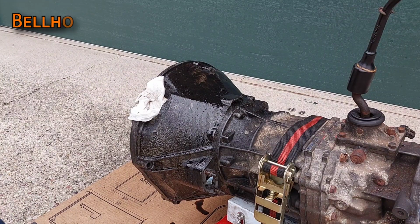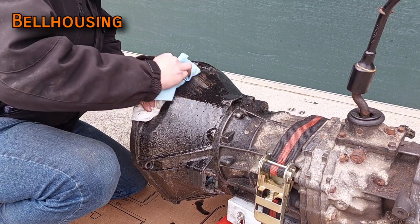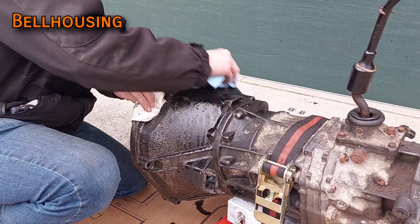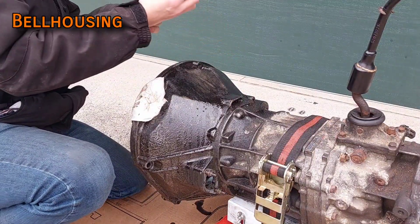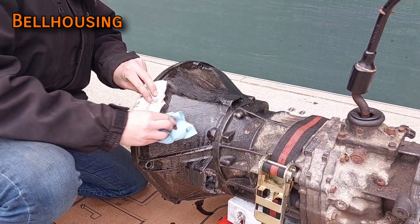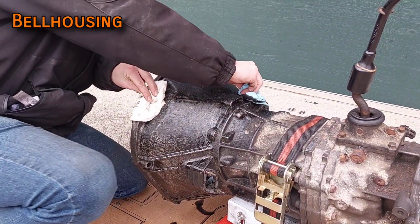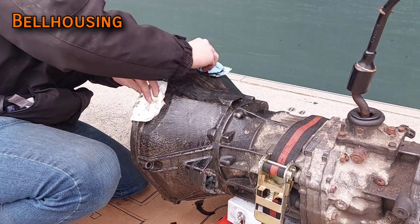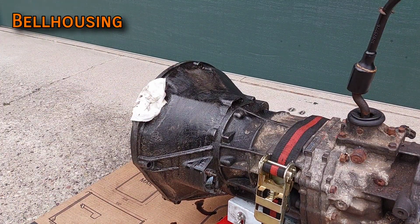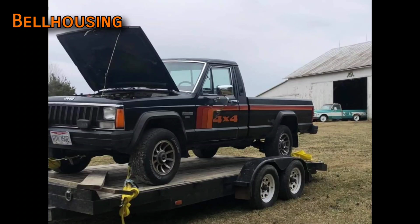You will need an applicable bell housing, but it'll probably already come with whatever transmission you're using. All 4.0s share the same transmission bolt pattern, so using an AX-15 or NV3550, you won't need any adapters. If you have a pre-1994 AX-15, you can switch it to an external slave cylinder by using a '94 plus bell housing, but when we go that far back in years, I can't guarantee input shaft size or spline counts will match, so tread cautiously.